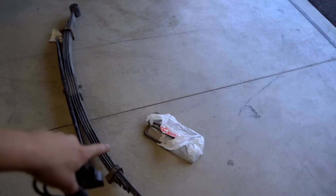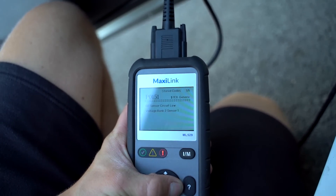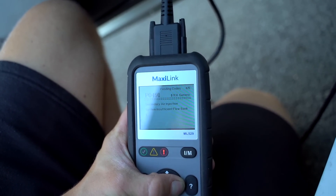Back in the shop now. On the way here the car came out of limp mode — I stopped, turned it off, started it back up and it was no longer in limp mode. I went ahead and scanned it, and they're still the same codes as before when we originally got the car: secondary air pump and bank 2 O2 sensor. Kind of odd that it went into limp mode briefly, but it's out now. We should fix those issues, but at least it's still drivable.